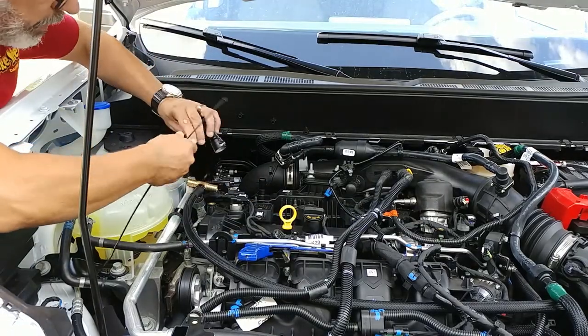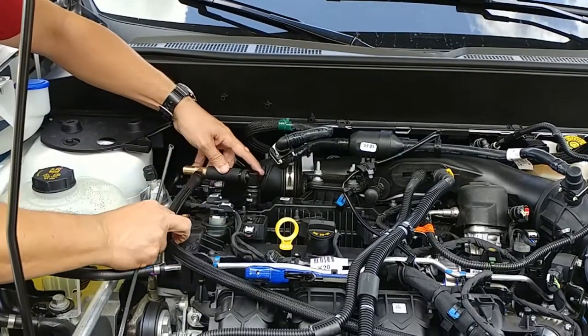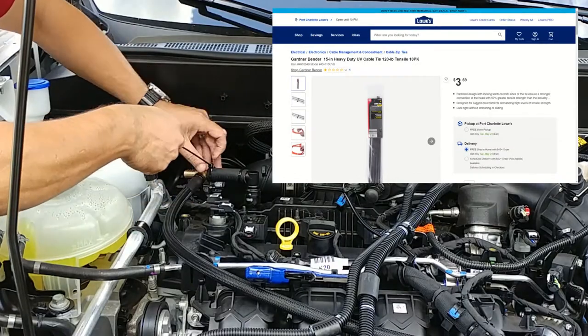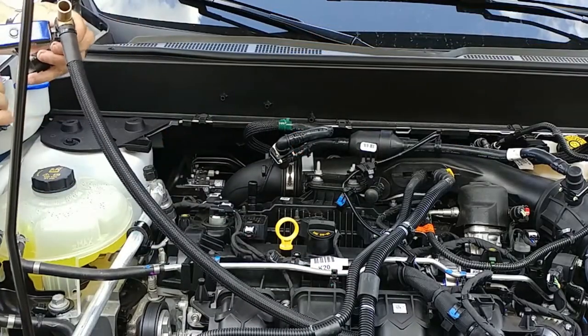After both the PCV and the manifold sides are done, I went to work on the top hose. I left the braids for a reason and also know that I'm not using clamps. These are 120 pound heavy duty zip ties and trust me when I say they grip. However, you need to use the zip tie tool if you want these things to be tight.